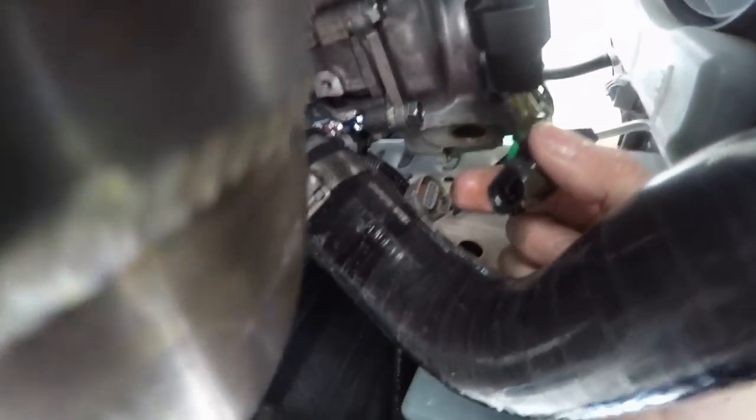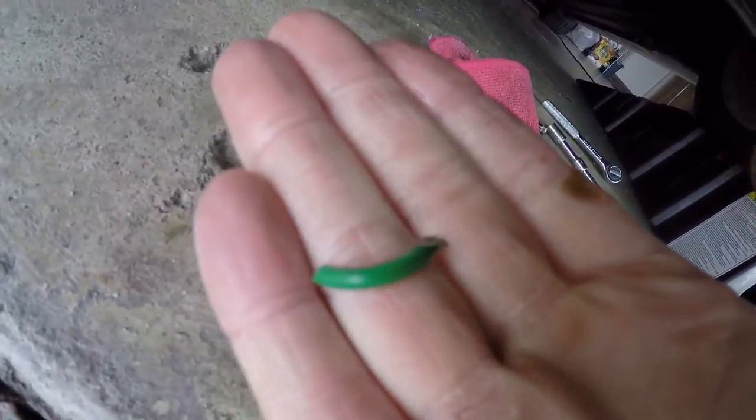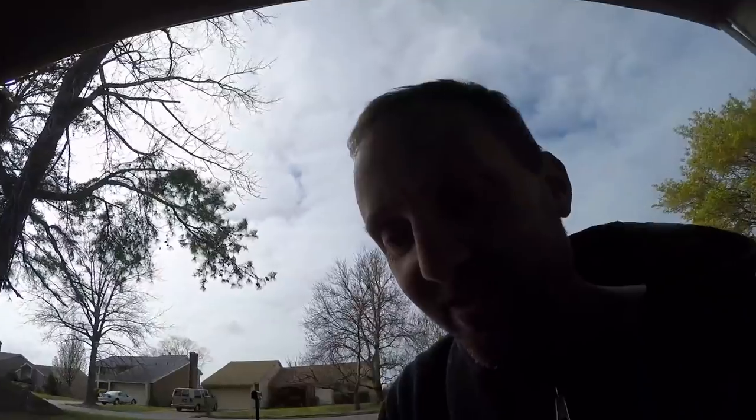Okay, let me pull out the seal and we'll take a look. Yes! I am happy with what I just found guys. The o-ring was too big, which I tried to do to solve the issue — bad idea. The o-ring broke and I literally have a huge oil leak coming out of there. I'm glad I solved it now. All the weird color oil is a little bit concerning, but I don't think I have any coolant issues in this car. That oil is a little bit strange in its coloration.